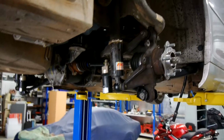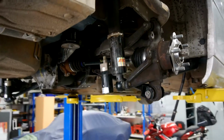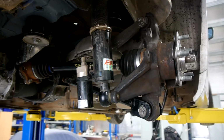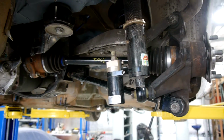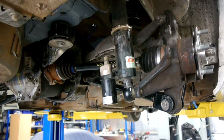Looks beautiful in there. I checked all the axle lengths with Dad. Or more like Dad checked all the axle lengths with me. And everything came up looking pretty good. It's right in the middle of the range, even on 3 degrees camber or 0 degrees camber. So very happy with that. Leaves lots of room for the axle to compress or expand if it needs to.